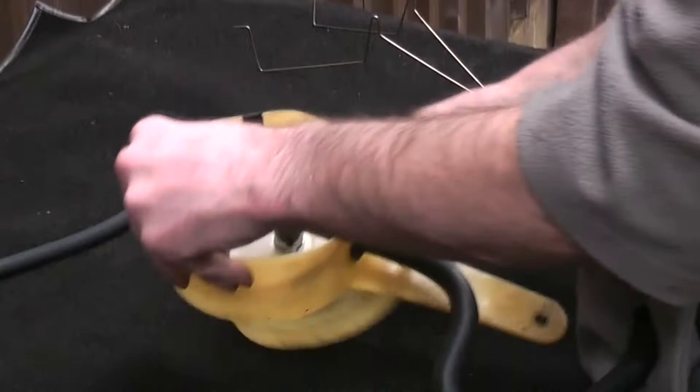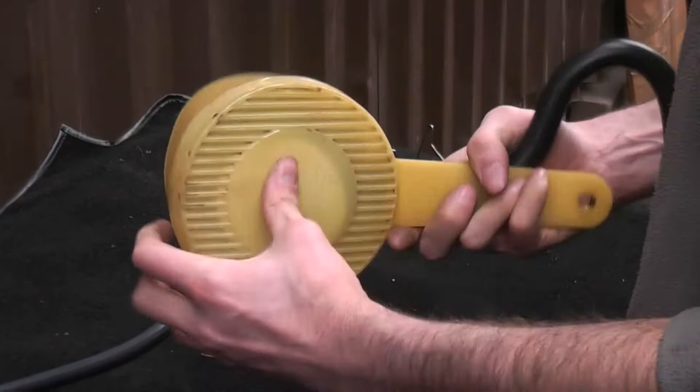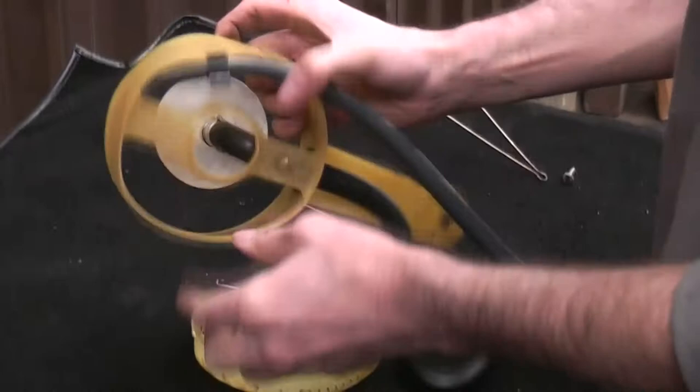Start with the baffle base. Some of the early cars are missing these, and they always seem slightly too small, but they do fit. Unfortunately it won't go through the hole in the top of the tank, so that's the bit you have to do when it's in the tank. Start by putting the return line into the side of the baffle. There's a clip here originally, but if that's missing you can just zip tie it to the central part. The important thing is simply that it drops back into the tank, into the baffle.